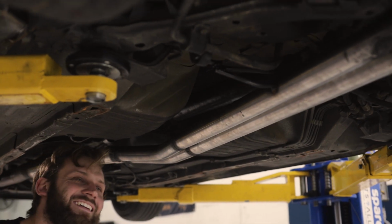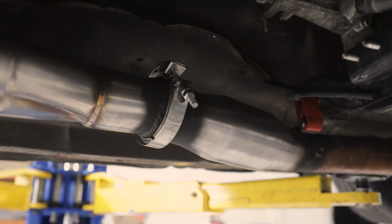James has buttoned up the exhaust. We've got twin pipes after the 50 cell Aeroflow cat under there. No mufflers because race car. Not even race car. We put a cat in there because street car, but no mufflers because race car. Balances out, right?